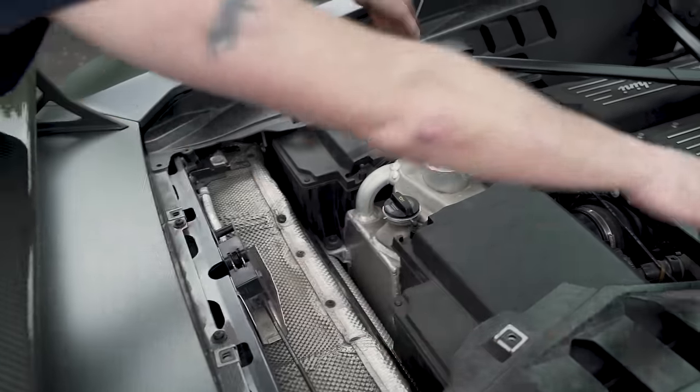We spent time building the new loom. The problem is all four signal wires from each wheel are blue and white — they're not different colors. So we had to take all three arch liners out, get to the three receivers, and do a continuity test between the receiver and the wiring to work out which was rear left, rear right, and right front. It's all working now — I just have to go through the test plan on the computer again to reset it, and job's a good one.